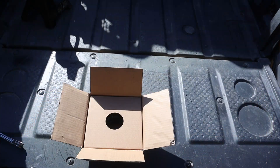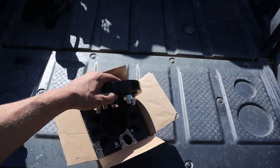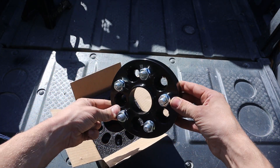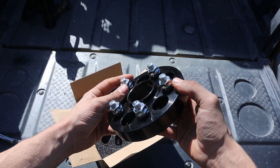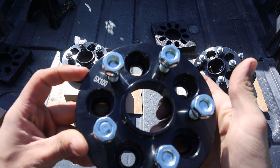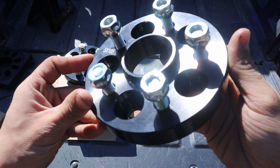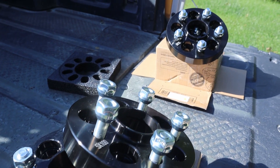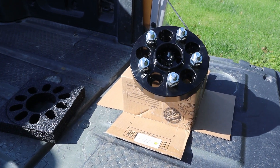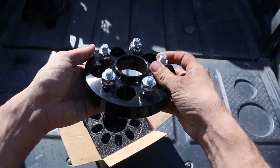We're qualified, right? Now, you guys might have seen some really bad things that have happened from poorly installed wheel spacers. These come in silver or black, and I opted for the black ones. You want to make sure you get hub-centric wheel spacers, because we have vibration problems enough as is with a lifted vehicle. You're going to need that little lip in there to help seat onto the old hub, onto your wheels, to avoid getting road vibration.